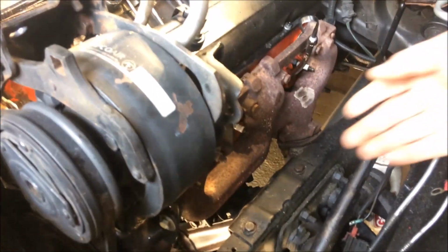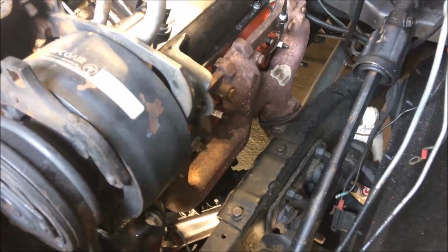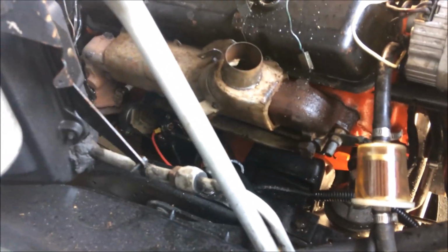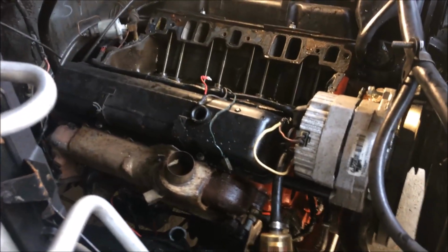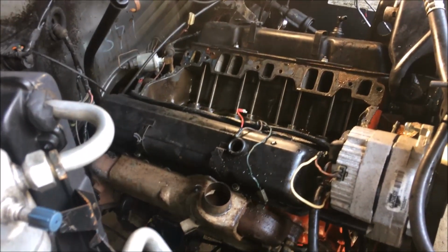There's going to be little things we got to do too, like this side over here. There's a piece of metal that goes in here on both sides that covers them spark plugs. And if you don't have them things on there, you're just going to kill your spark plug boots. If you look at that other side, they're on there. And on the back, they bent one of them out of the way. We're going to have to take a plug out and straighten it up. See it over there? You don't have to have them, but it's stupid not to have them because you're just going to eat spark plug wires up. They just melt them. So there's a lot of little stuff that people overlook that you kind of need.